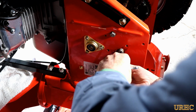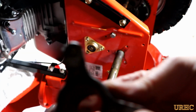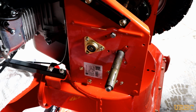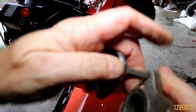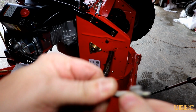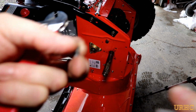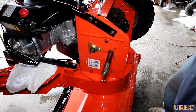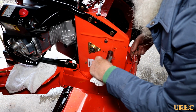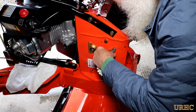I was able to get most of the way through, but it wasn't going quite perfectly straight, so I wound up having to take that little housing off there and finish drilling it out on the table. Then I went back and took one of those 4-corner easy outs that you drive in there with a hammer, and they dig right into the hole, and then I was able to screw that threaded piece out. A little bit of damage to the aluminum there from where the drill might have tapped it, but it wasn't too bad looking. And luckily the bolts that held the cover on were the exact same size, so I took one of them to replace the damaged one, and got this all put back together.